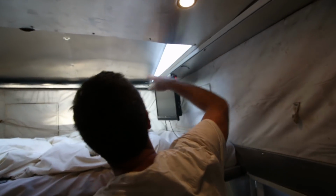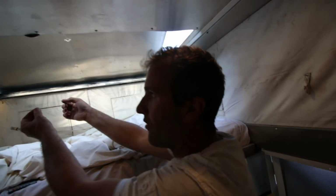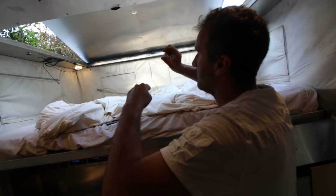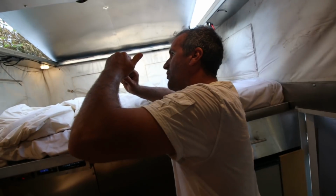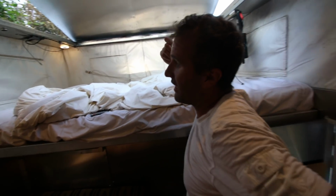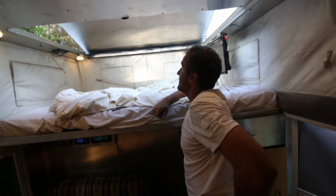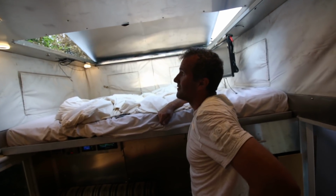Are you getting any leaks? No, that's sealed pretty good. I did a half-inch lip all the way around. I welded the whole thing. So the water has to pass a 1-inch foam seal when you pull it down, it's tight, go through there and then go through the lip. I drove it one day when it was raining, and I didn't have any leak. That's good. Awesome. Hopefully in the future it stays that way, not leaking.